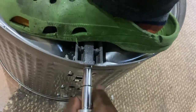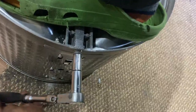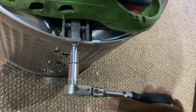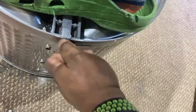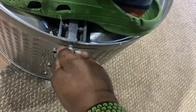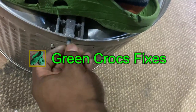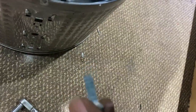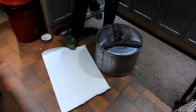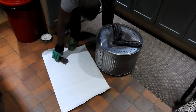I'm going to undo the spider. You've got to take care — you've got to turn it backwards and forwards as you're undoing it, or you will snap the bolts off inside. I need the bolts for the new spider, so I'm taking my time going backwards and forwards to undo the three retaining bolts. That's the first one out — still got the thread lock on it. You can see that one bolt is out.